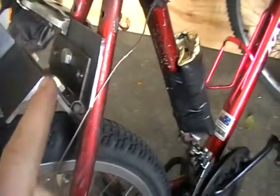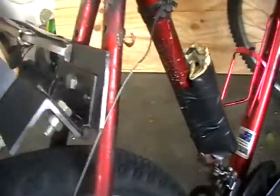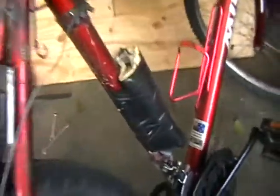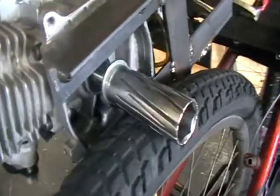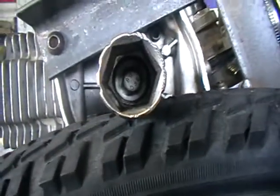And then I have the hinge and then I just have a bit of flat steel — just so I can weld that flat steel to the bike and then bolt the hinge to it. And for the drive, it's just a socket, and it's connected to the crankshaft with a bolt down there.